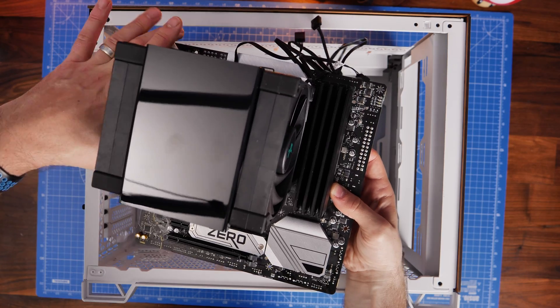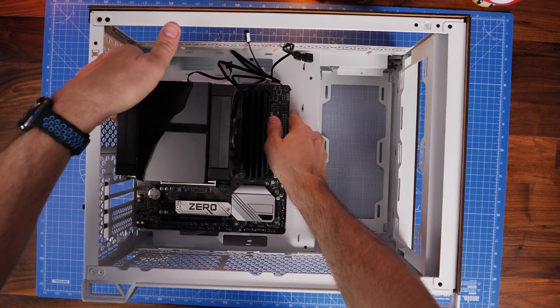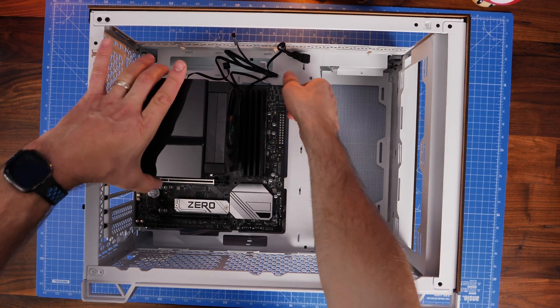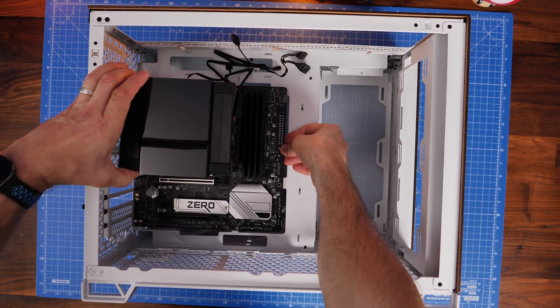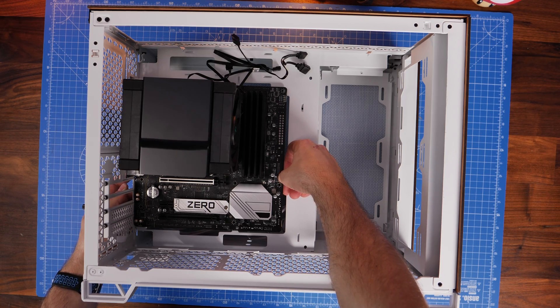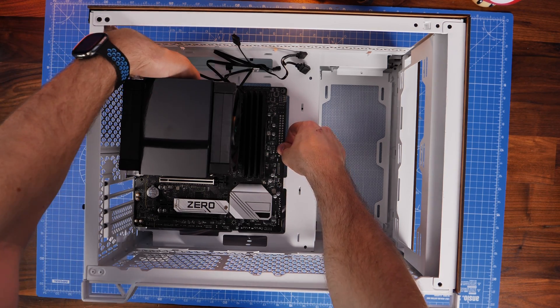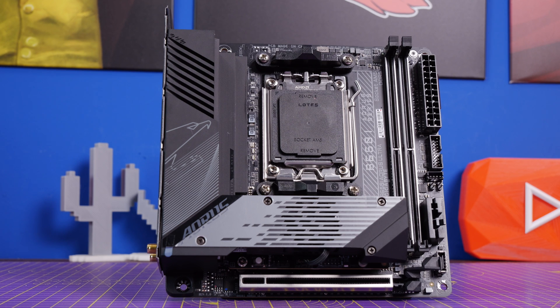USB connections are usually at the bottom middle of the motherboard — on this rear-connect one they're on the bottom back. Don't forget that connection or you won't be able to control the data on the display. Then go about installing the motherboard in your case — this is the Corsair 2500D Airflow — and neaten those cables up, running the excess to the rear to tidy everything up.